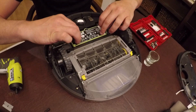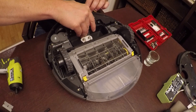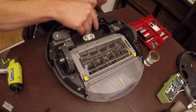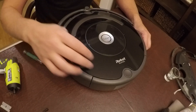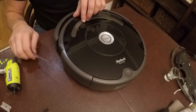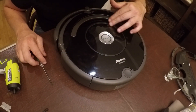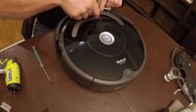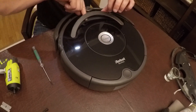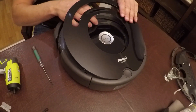Also remove your battery — it comes right out. Now your bumper is free under here, but it's also attached to a wire, so we're not even going to need to remove this. Quick trick to removing this plastic up here: don't try prying around it. You can get it off that way but you're likely going to damage something. There's a quick release right here — if you hold this up, then you can pull the plastic out easily.